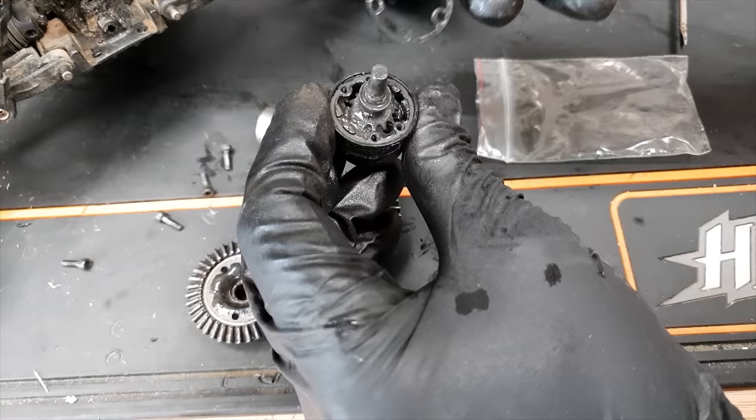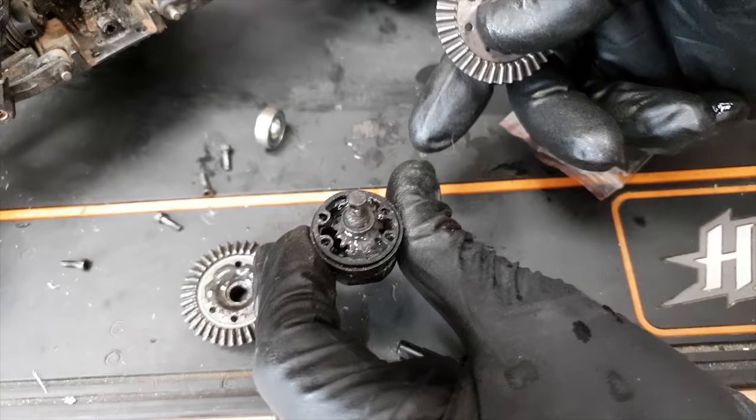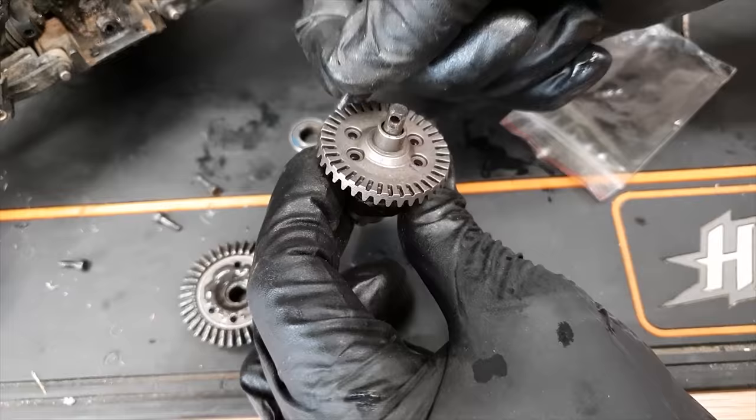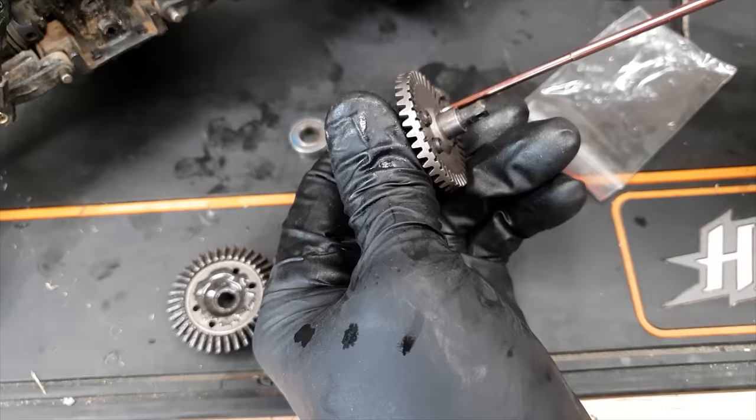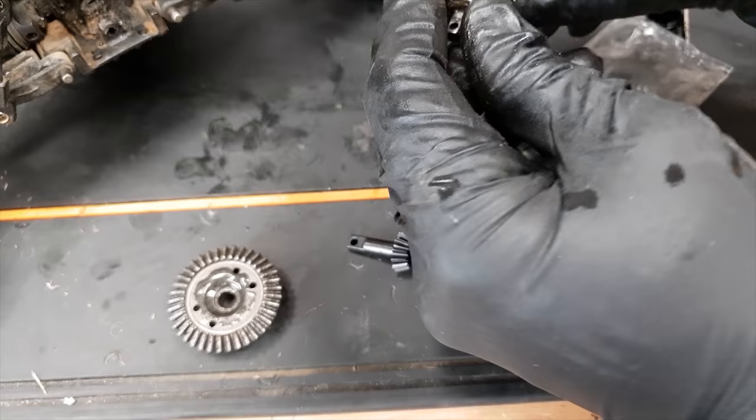Here's a nice shiny new one. I'll fit the gasket and top it up a little bit — it looks like it could do with a bit more in there. There's no O-ring attached here. The bearings are still relatively free. I would normally give these bearings a service — ping the shields off and make sure they're clean — but this car's due a full rebuild anyway and I'm going to put new bearings in everything soon, so I'm not going to bother.